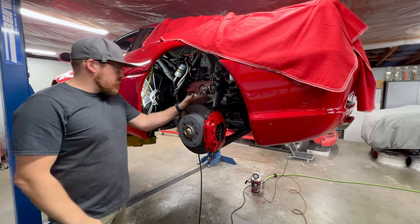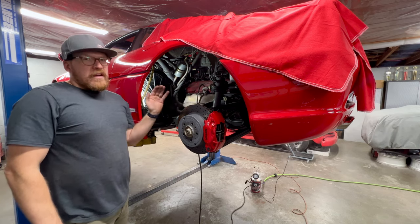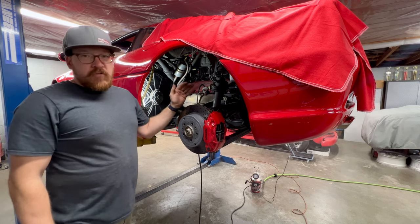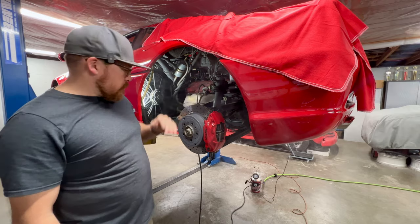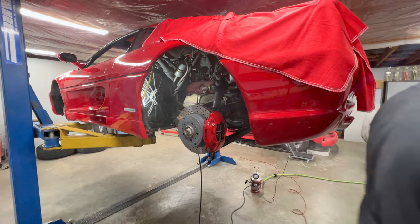So that's a big relief. This car does not need manifolds. That's a pretty pricey repair. So one thing to always check on a 355, do it when the engine's cold, especially if you're looking to buy one. Check the manifolds, have someone check it. You want to be sure you're not going to have to buy a set. And I got to shut this smoke off. Woo!